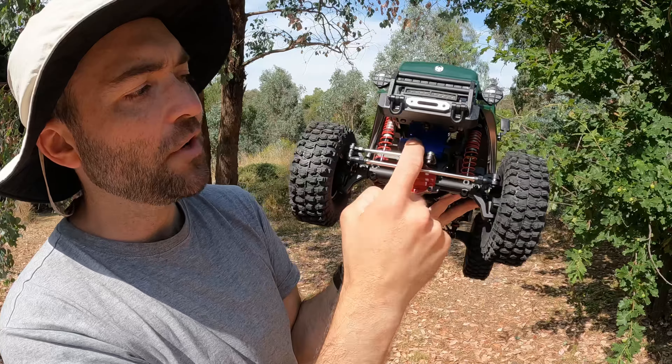You've got metal axle casings. All around, this is metal where it wants to be, and plastic where it doesn't. You don't want metal on your skid — metal doesn't slide over rocks as easily as plastic does. This plastic feels a little bit more brittle than some of the lovely oily, bendy plastics you get in some models. Red Cat does it really well, Traxxas too. The X-Maxx is made of that bendy oily plastic — that's why they don't break too much. Having metal at least, while it's not great, it's got a rounded profile to it, so that'll help on clearing rocks.